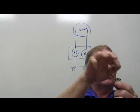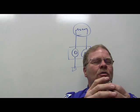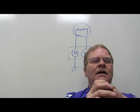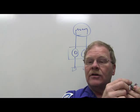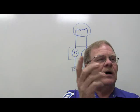If you hook to these two wires and you turn it the same way, the resistance will go down. You got me? So basically, you're just going to pick two of the three, a middle one and one of the side ones, always a middle one and a side one, and you can hook it up to an engine coolant temperature sensor, and you can watch your scan tool, and you can turn this knob, and you can change that reading.